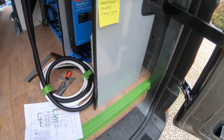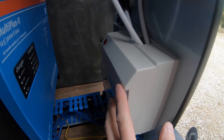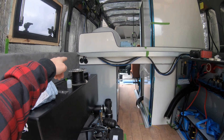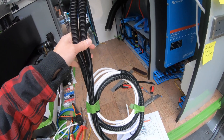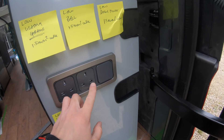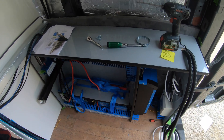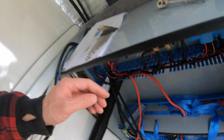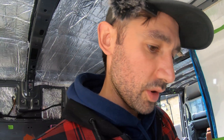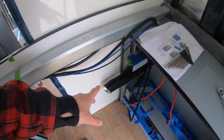So where we're up to: all my 240V cables are now run and the fuse board is now finished — that is fully wired up. I've got 240V running over here and then down that way, because we're getting a bit chock-a-block with wires that end. That is for the front area — one is for the hob and the other one is for the socket. These sockets are wired up here as well, so all the 240V's done. The cupboard is in for what should be the final time — bolted back again so that's pretty solid. I've put these pocket hole points in and I am going to screw it down, because when I was driving around in it this week it was jumping all over the place. The heat induct is now in, running through to the bathroom. Really, we are ready to go.